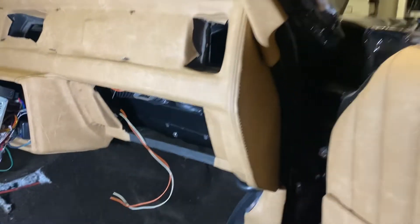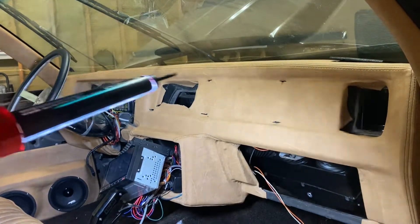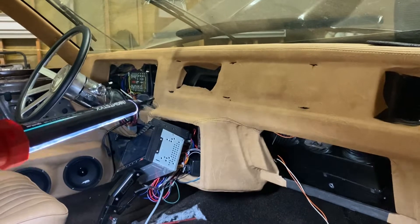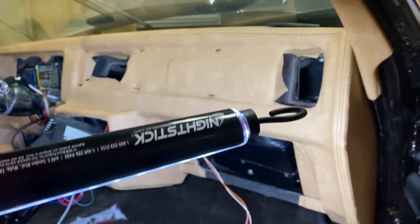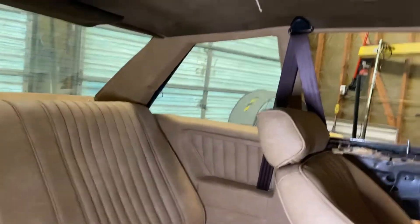Because when I shoved it in there I kind of broke loose the vent that I glued. If I'd tried to put it at the bottom I'd have had no problem clearing when I went to push it back, because the lines from the defrost vents — the one that goes over to the driver's side — made it a little tight. I left the other one by the driver alone. For future reference, just put both the vents in at the bottom and you'll have no problem clearing.